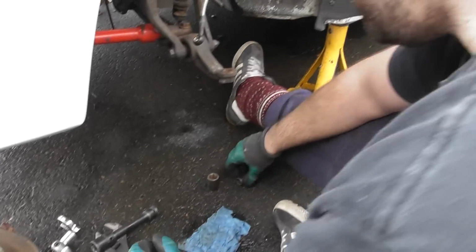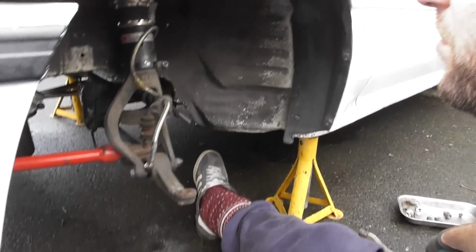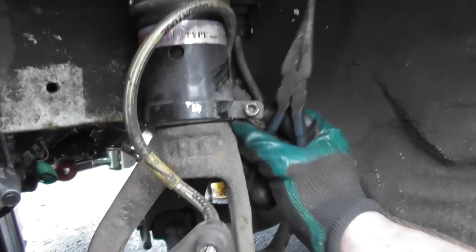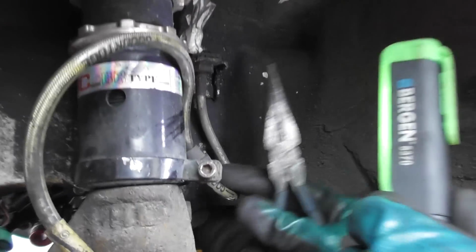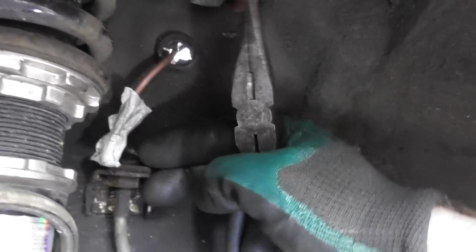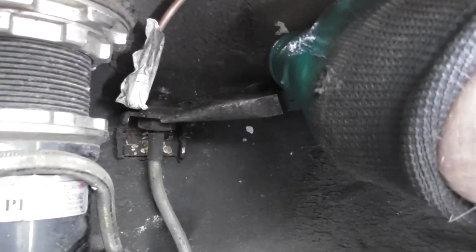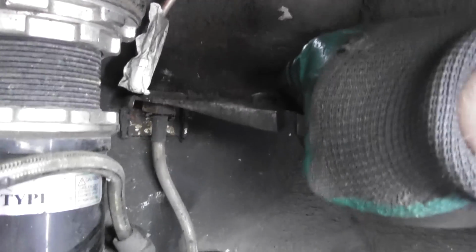And then, as you saw before, I changed the brake lines, the hard lines here, so that's got some tape. So this is a Goodridge hose here. It's already off, apart from it's held on by a 10mm at the back here, but then this is the new solid hard line, and then this little clip on here, so you can work these off.